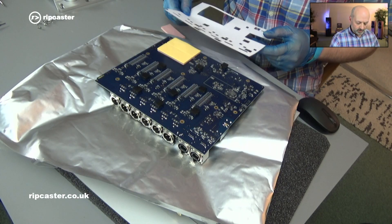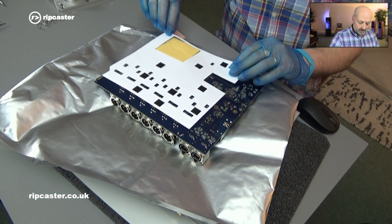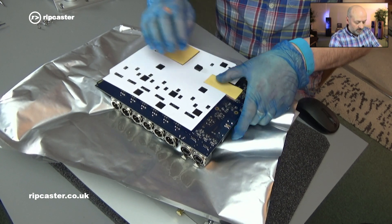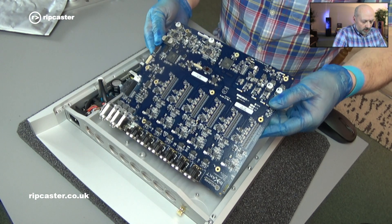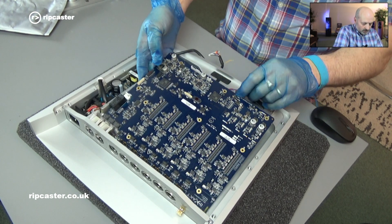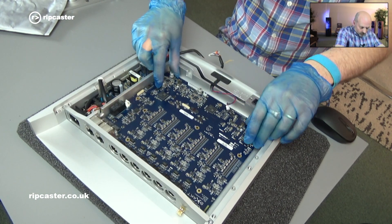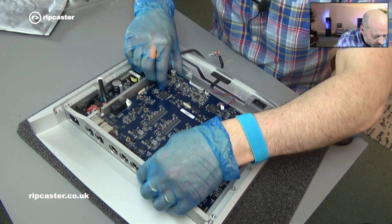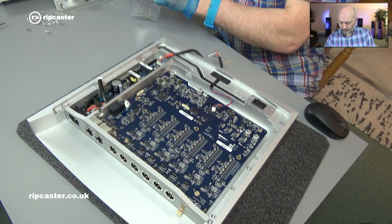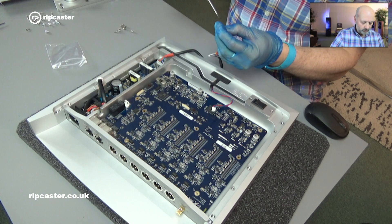Here's the new board — I've turned it upside down. I just want to make sure I've got all the heat pads in the right place, and this template helps me do that. There's one here that I just need to sit in and give a little bit of pressure. So we're going to put this in — we need to angle it again. We've checked that the heat pads are all in the right place, clear the cables out of the way, and touch down. So we've sat the motherboard in there. Linn give us a new set of nine screws in this instance to fit to the motherboard.